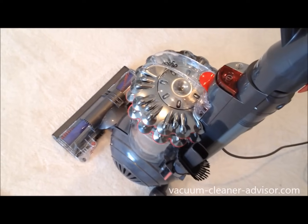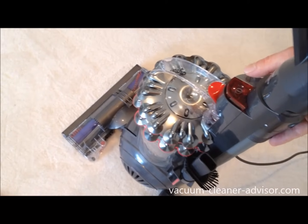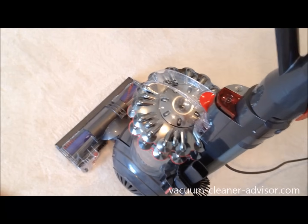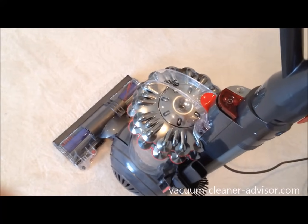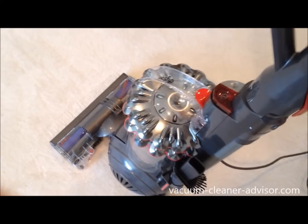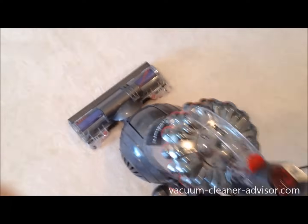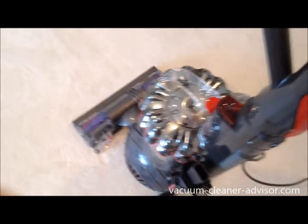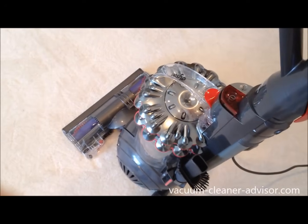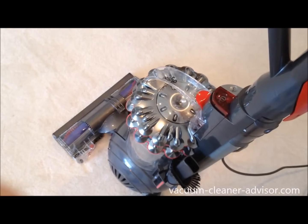This vacuum has a motorized brush roll and only a few controls. Here we can see the vacuum power on/off, and on this side is the brush roll on/off. When the machine is in the upright position, even if the brush roll controls are on, the brush roll itself won't spin — that's there to help ensure the carpet doesn't get burned. As soon as we tilt the machine back, the brush roll engages. When we put it back in the upright position it turns off automatically.